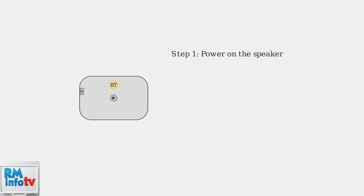When pairing fails, resetting your DeWalt Bluetooth speaker often resolves connectivity issues. Here's how to perform a standard reset. With the speaker powered on, press and hold the Bluetooth button until the LED starts blinking. This indicates the speaker has been reset and is ready for pairing.